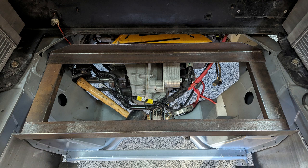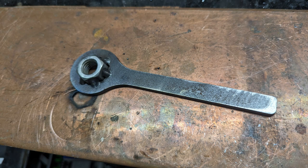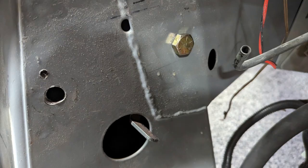This will be a tray that doubles as not only the battery support, but it also becomes the strut tower brace that was removed in order to make room for this. So it needs to be securely mounted, and unfortunately there's not a lot of access behind it for the backer nuts in the frame. Normally you could use a rivet nut, but since this is a high-stress part, I decided to make some backer wrenches that will live in the car. These are CNC cut, the nut is welded to them, and I bent a little tab so that once you put it into the access hole and bolt it down, that tab becomes the backer wrench. You can really get a very good clamp load on this, and it'll be a nice secure with a wide flange — a very durable part.